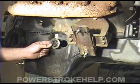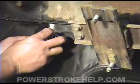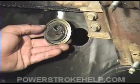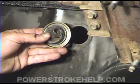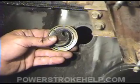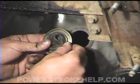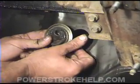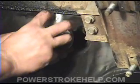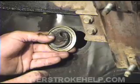I've got to warn you about replacing this. On the outside, you'll see a very thin nut that attaches to this. A lot of people will go ahead and try to tighten it to see if they can get it to quit leaking, and that's a mistake. All that's going to do is make this swollen-up O-ring just squish out, and it's going to leak even worse. If you continue to tighten it, you will deform that ring and you'll never get the thing to work right.